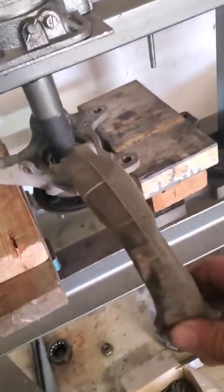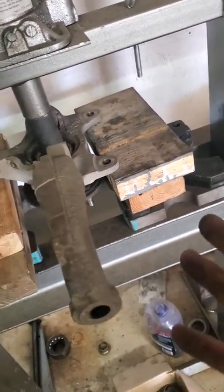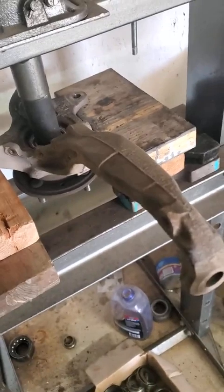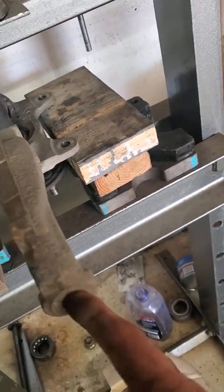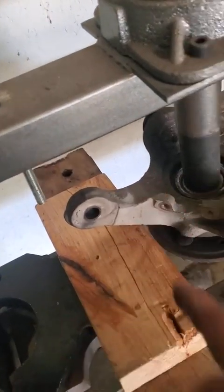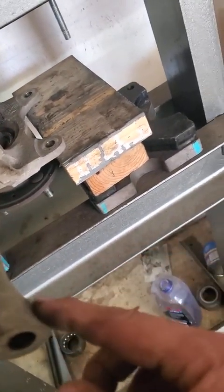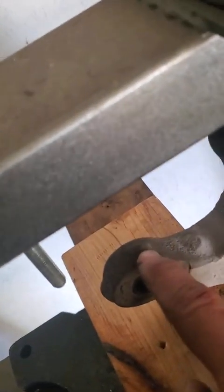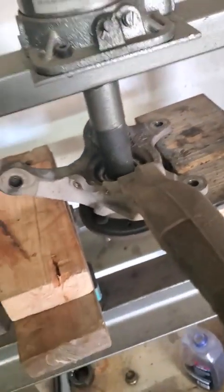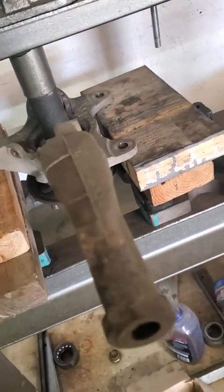That'll be it. Now, guys, I'll give you some advice, because you're going to change these fairly often, depending how many miles you put on your Integra. So what I recommend is, put a little bit of lube up in there, and right in here, when you put these back together. That way, when you go pounding on these pieces, because that's what these little nubs are, they're to hit with a hammer to jar it so it'll just pop loose. Mine popped loose just fine, and it's been on there for probably 60, 70, 80,000 miles. It's been a while since I've changed them.